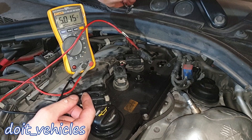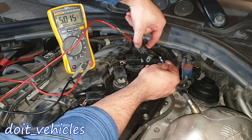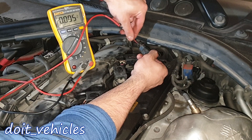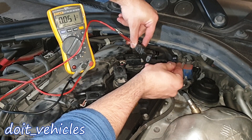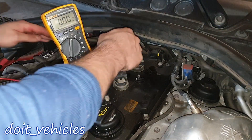I want to see which one of these is going to be the signal wire. I'm going to put a piece of metal here — it looks like the signal doesn't drop, so this might be the reference wire. Now let's see the middle one. Since we've got 4.8V, yes, this is the signal wire. So this was the exhaust sensor — now let's see the intake sensor.